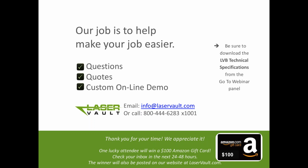But if you're looking for your basic daily saves of your libraries, your objects, IFS, those types of things on a daily and weekly basis, and you want to do it through TCP/IP without adding a fiber channel or a SAS card to your iSeries, this is a really simple solution. Also, if you're doing under a terabyte of data on your backups. If you're doing over that, you might want to look at a higher speed backup like the UBD or VTL solution that uses fiber channel or SAS, which would be a 6, 8 or 16 gig connection, which gives you a high speed connection for faster backups compared to tape.